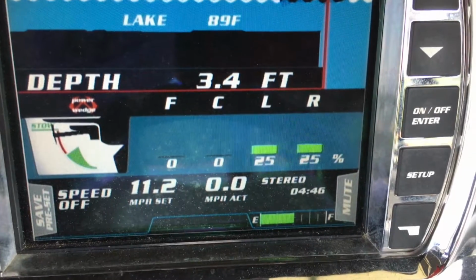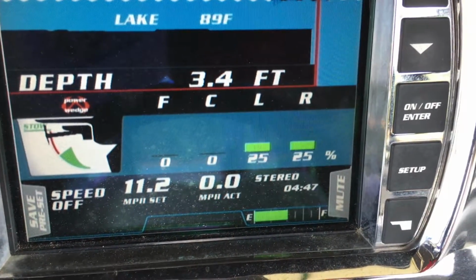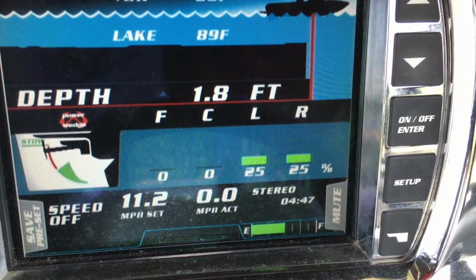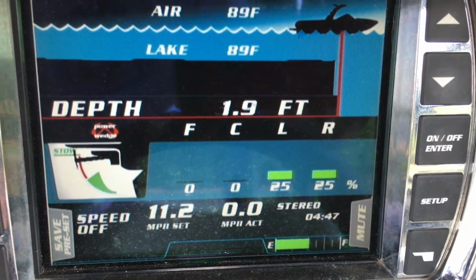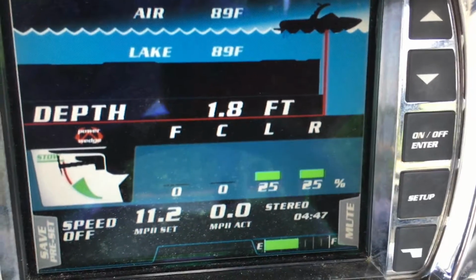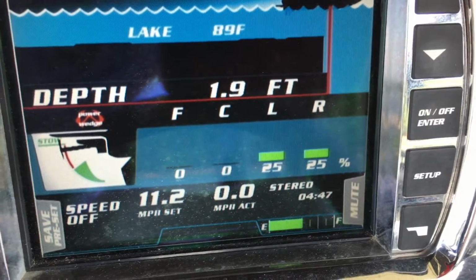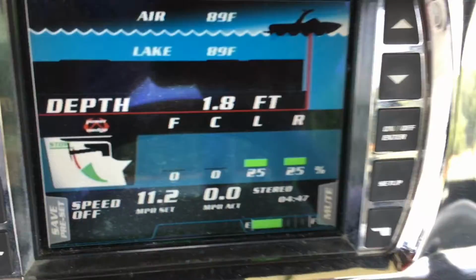I am going to, well, you can see the right one is just flickering on and off. My gauges work fine. They worked fine before I put the bags in, so I don't have a problem with the floats in there. So I'm going to give it a few minutes and then come back and see if any more is drained in there. Then I may also pull the vent hose off of the bag and see what happens.